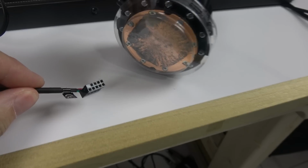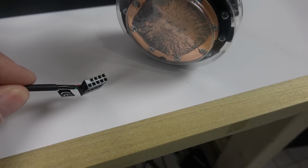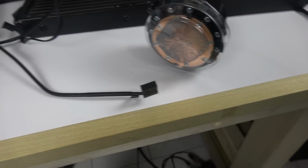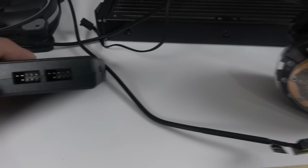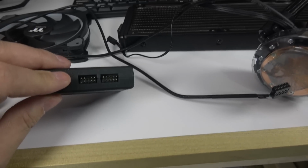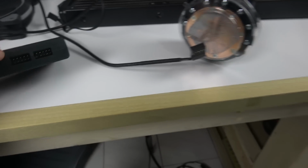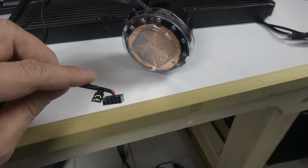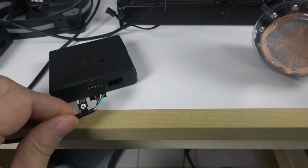So this basically is a USB 2 header. It's got 9 pins. All right, you got the empty one. It's USB 2. The problem is the pin out when you're gonna install it in the controller. I'm gonna show the controller after, but it goes in the controller in one of these connectors, in those slots here. In every one of my videos I always talk about the slots. I like the slots, apparently. So here is the 9-pin connector. You will put this from the water block into one of these things right there. This is what you're gonna do as one of the fans.